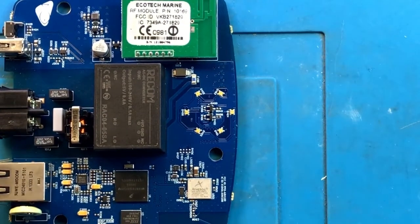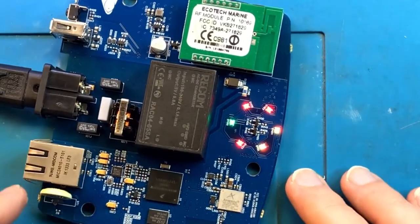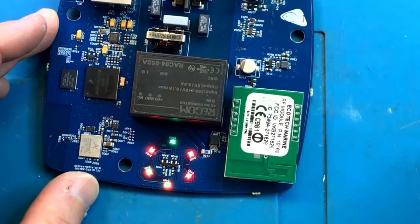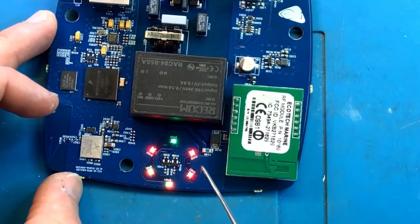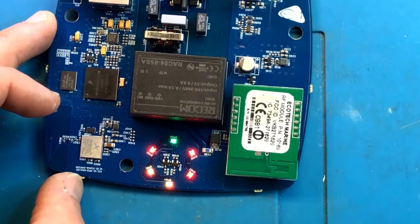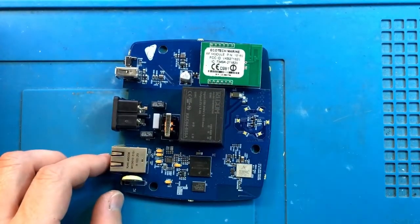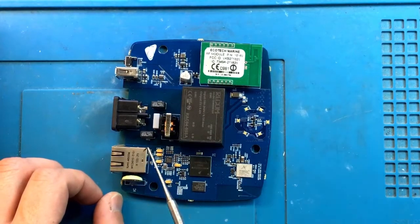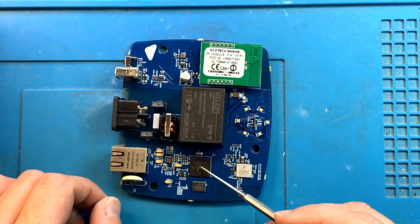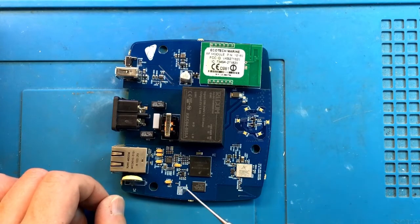I'm going to go ahead and plug it in again — carefully, because I'm providing AC voltage. And there is the set of LEDs: green, red, red, orange, orange, and red. That's the code we have to deal with. Since the LEDs light up, it means that AC power works and AC-to-DC conversion works, otherwise we wouldn't be able to do anything. The controller likely works because that's the unit that sets the color scheme for the LEDs, so that's probably good.